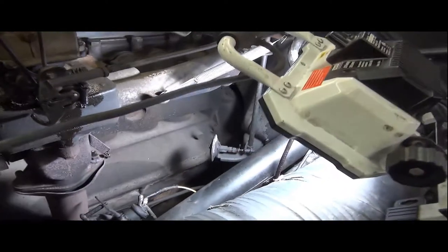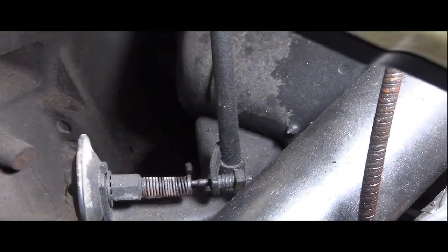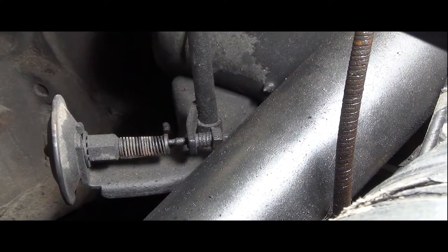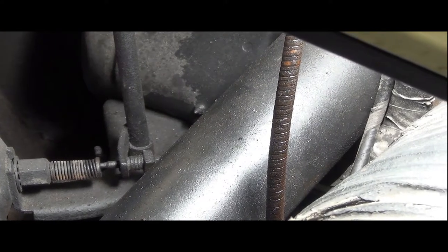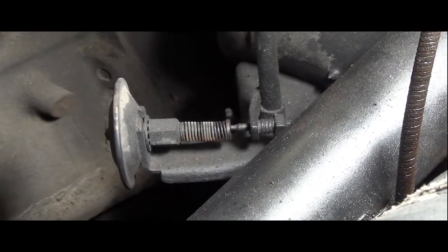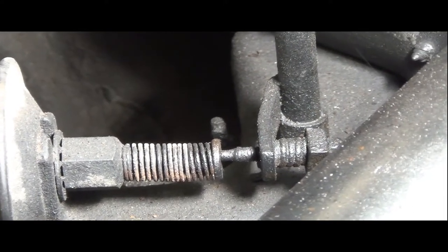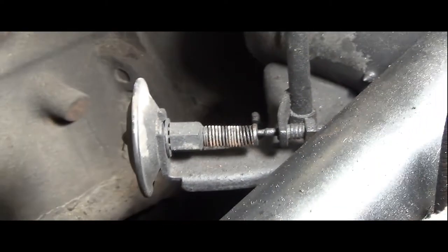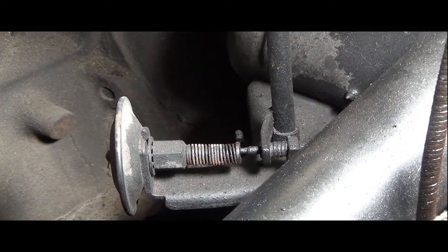There it is. Nothing more than a glorified rubber bumper stop, so that if you were to just zap your foot off the gas pedal and the throttle comes crashing back down, you don't kill or stall the motor or roll it by shutting off vacuum so violently to it. Gosh, bad camera work, sorry. That is supposed to contact a little bit early and gently bring the valves closed, so that we don't have a stalling your car type of symptom going on.